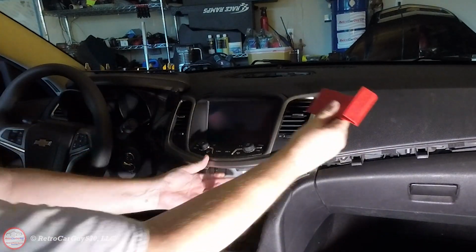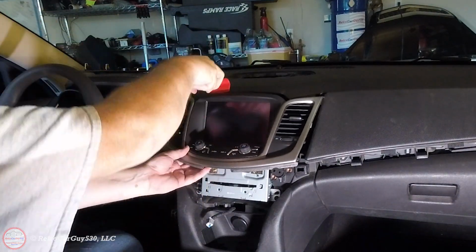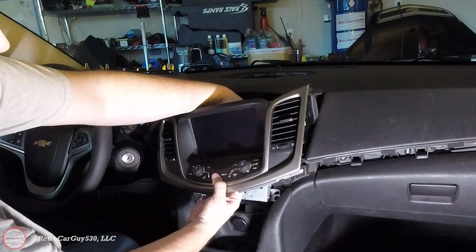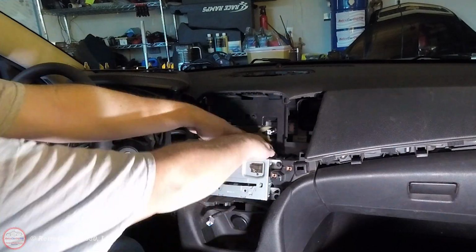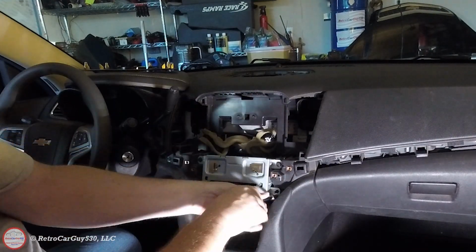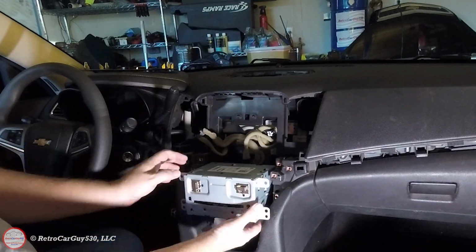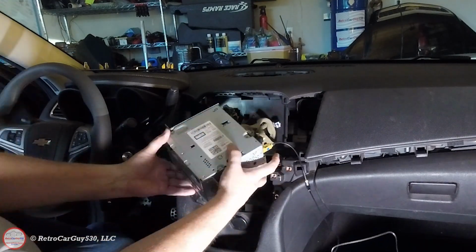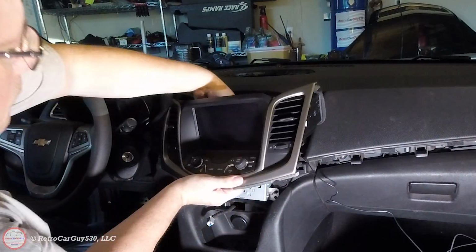And then you go around the trim of the radio display, and you need to lift up on the gear selector just a little bit to let the left-hand side around the vent there to clear the gear selector. And then there's three connectors on the back of the radio display to allow that to be disconnected and removed. Then there's four 7mm bolts for the radio head unit, and then you can pull that out. And there are several connectors on the back, as you saw on the previous picture of the back end of that. But in this case, I'm actually adding the XM antenna and the adapter for this to do a quick test to make sure it works.